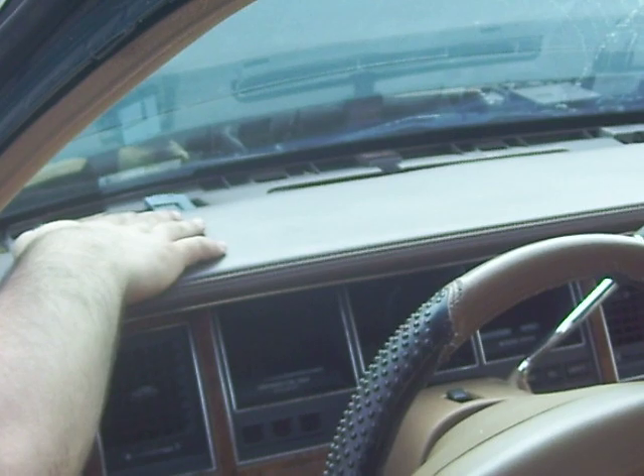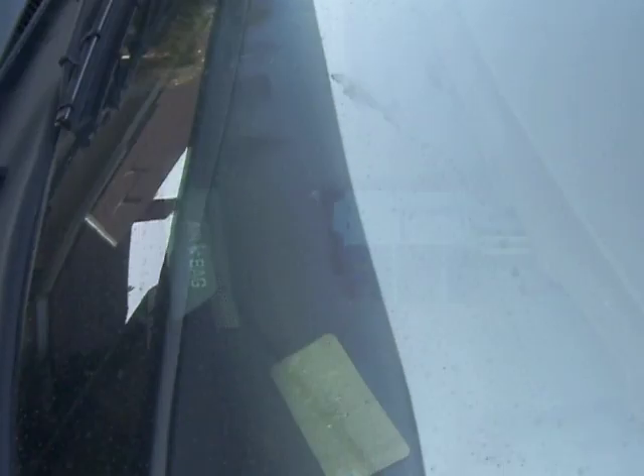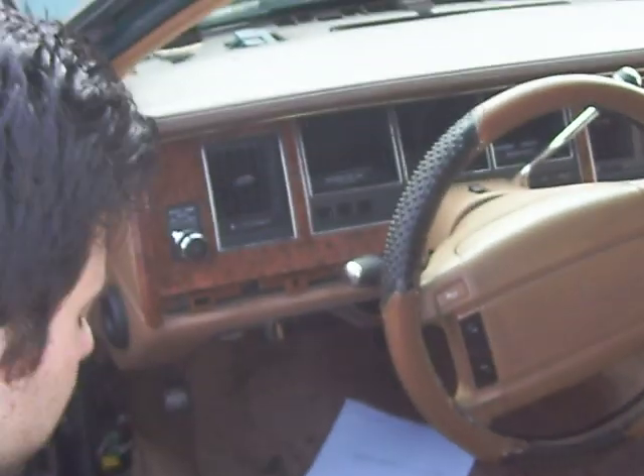And then on the top here on the dash, I went ahead and pulled the plastic — it's all plastic on the front where the defroster is — because you're going to need to get to all these bolts up on top of the window sill here. I think there's like six or seven of them. I printed out the tech write-up on the webpage on how to do it step by step, but it's always nice to have a video.